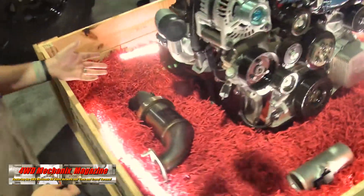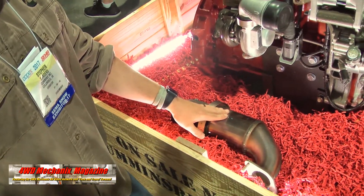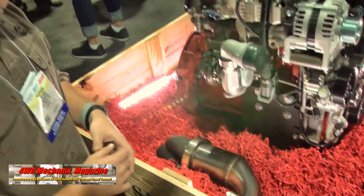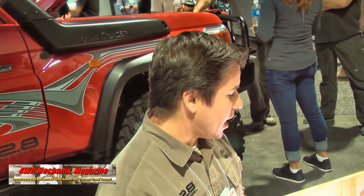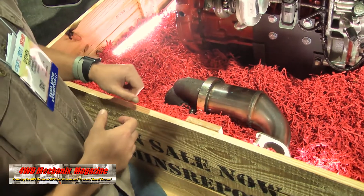When you open your box, you'll have an engine-mounted DOC — a diesel oxidation catalyst, which is a passive flow-through device. So it's not a DPF; there's no performance gain to get rid of it. It cleans up that cold-start hydrocarbon smell. If you can't fit it here, there is a little room to move it downstream depending on your packaging requirements.